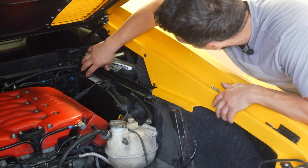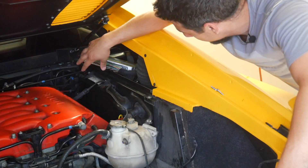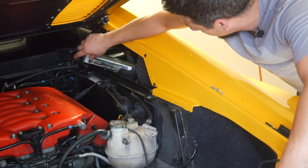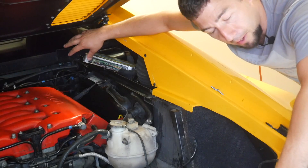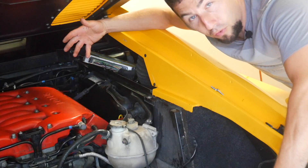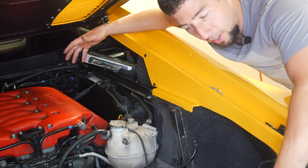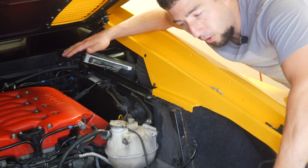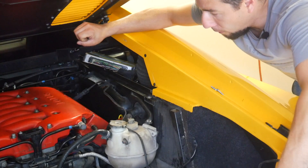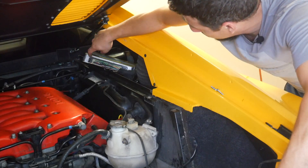The computer on these cars is located back behind this cover — it's not the easiest thing to get to. You pretty much have to be in the engine bay to take it out. There are some trim screws, then that panel comes out, and then there are four 8mm bolts you have to be very careful not to drop. I pulled the computer out and opened it. On some older Ford and GM stuff you can see where capacitors have leaked and caused trace damage or a broken leg. This one has no signs of that, no signs of corrosion — but that means the problem is harder to find. We're going to verify there is an actual problem with the ECM itself.